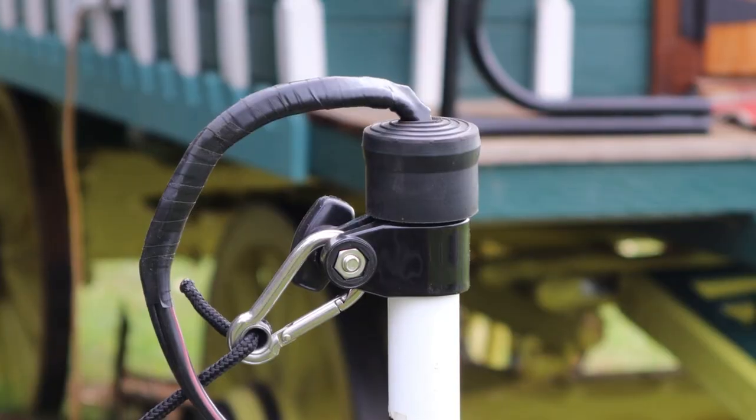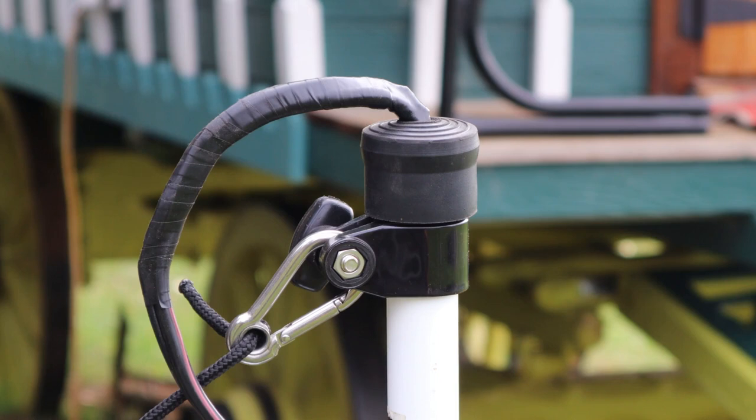The first thing I did of course was to remove the head of the motor and disconnect the wires. I haven't got any footage on that and I won't go through how I did that, but there are a multitude of videos on wiring in a marine plug to your headless trolling motor. Once I had sourced the correct gauge wire to connect up the wires coming up the shaft of the motor, I used a chair stopper with a tightly drilled hole and very taped up, so no ingress there — no water can get in.